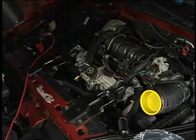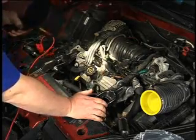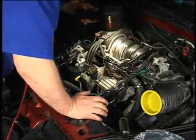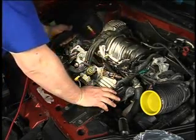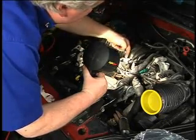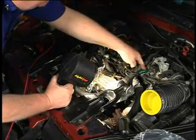Smoke's rolling — let's get the bright light on. And lo and behold, we've got other leaks. I've got a serious leak here: an intake manifold gasket leaking straight out. And I've got number two injector leaking around the O-rings. And there's a split right here too — it was holding when the other leaks were leaking, but now it's leaking a little around the split. So we definitely need a boot, injector O-rings, an intake manifold gasket, a fitting on the intake, and a new valve cover.